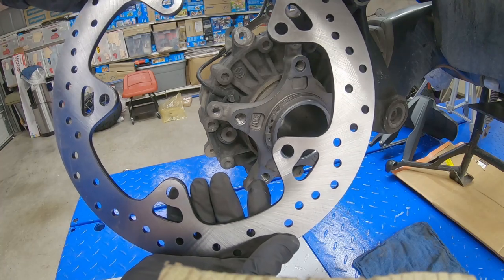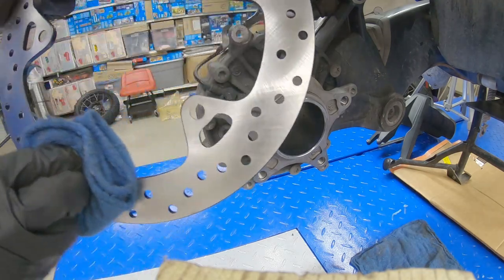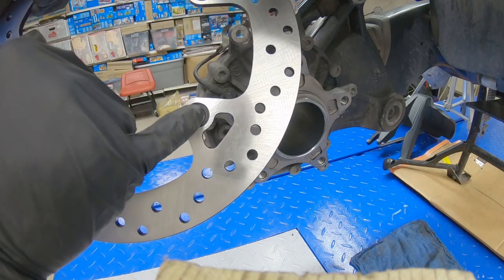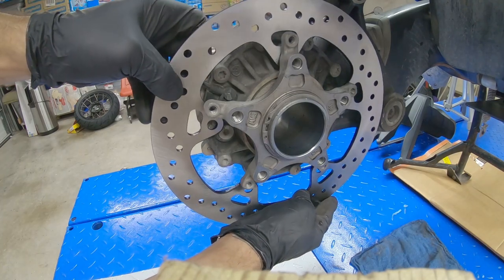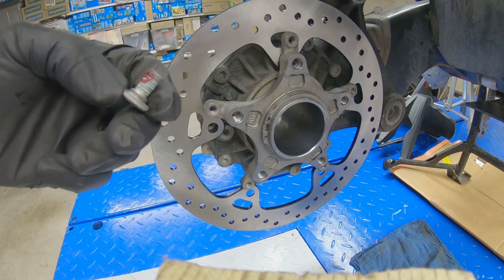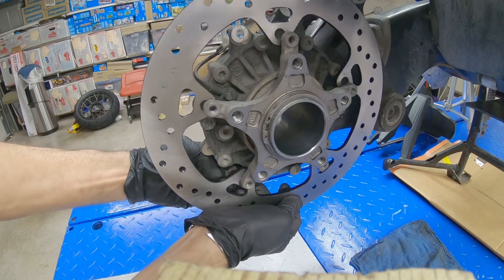This is the new rotor. From both sides. Like I said, remember, this little flange for the bolts is going to be on the other side, like this. Of course, we're going to use Loctite. So I put a little bit on each bolt of the rotor. We try to find this space so that way we can put the bolts. So from right here, we can hold it.